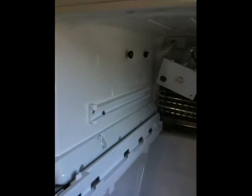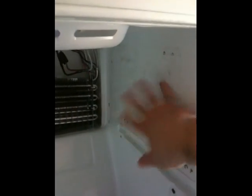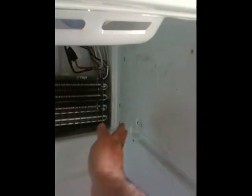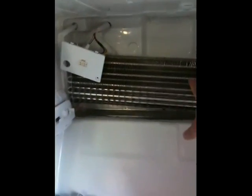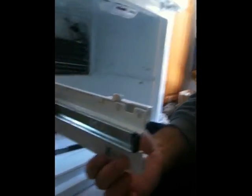There are two clips on the ice maker - pop those off and pull out the plug. Once you do that, you'll be left with brackets on both sides. There are two screws, and they fit into a notch in the back, so bend them out and they pop straight out - same thing down here, three of those. Then you have your back piece - just pop it out and slide it out. There's another plug you have to undo to get the whole piece off. I also took off the front drawer, which is super easy - only three screws.